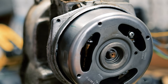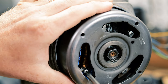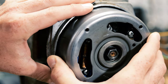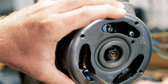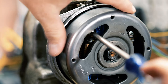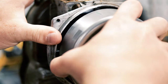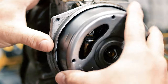Put your flywheel back on and loosen up your coil. You can see it's rotating and rubbing because of that tape providing the clearance. Once the coil is in a nice place, tighten the coils back up, then take your flywheel off again and remove your tape. Now you can reinstall the flywheel and it'll be properly clearanced.